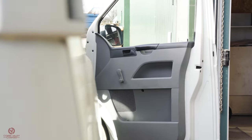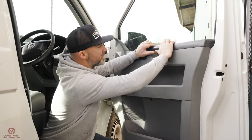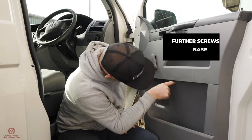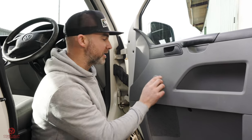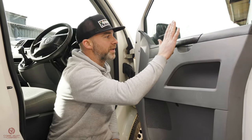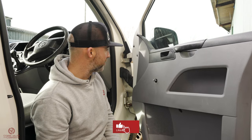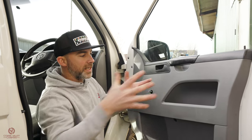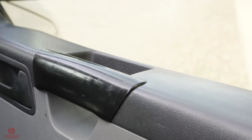The T5 door card is actually quite easy to remove — you just locate the fastenings, undo them, and pop the whole door card off. You've got a couple of fastenings under here, one fastening in the hole in the middle, and then you've got to remove the door handle. It's a case of removing the screws, the fastening, then popping the holder off using a trim tool. Once the poppers are off, you lift the door up and over the locking pin, then unhook the cable that runs from the door handle up to the lock.